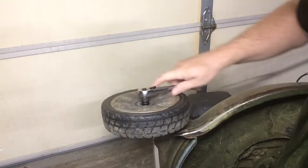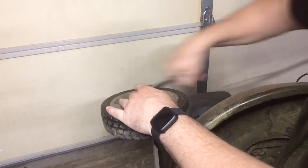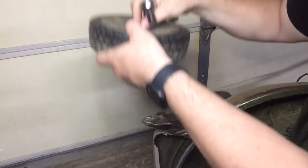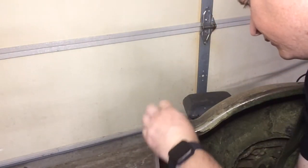I'm going to take a 12-millimeter wrench and take out the bolt for the front wheel — we're going to work on the front wheel first. Once you have the bolt removed, take off the wheel and clean up the debris a little bit.